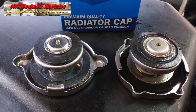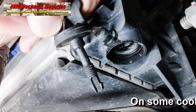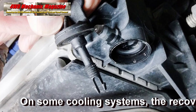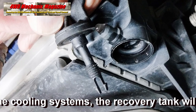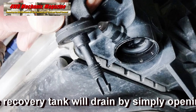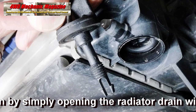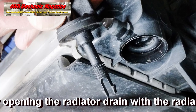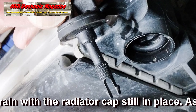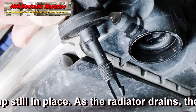The engine and cooling system are allowed to cool completely before loosening the radiator drain petcock. For a threaded stem plug, Ram models built during 2003 to 2005, I highly recommend not unthreading the plug stem completely. The threads are plastic and act like it. Once removed, the plug is difficult and often impossible to start back into the radiator drain seat threads. I drain the system in two cycles. This takes more time than a dealership or most shops will allot. The engine and cooling system must cool down completely between each draining.